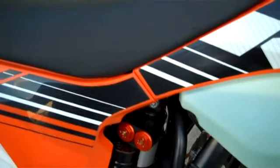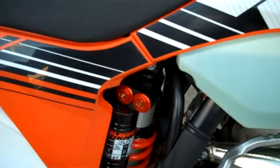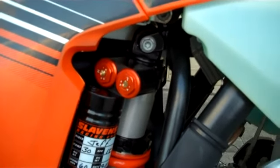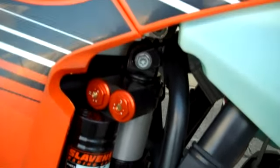This is one of our new items here, made by CSR. It's a different shock top — it gives the shock more flow and a lot more adjustability. There are 50 clicks on the high-speed alone. It's very tunable.